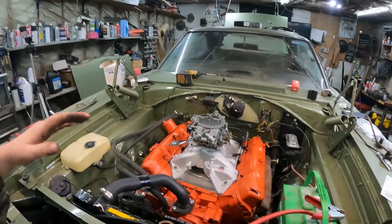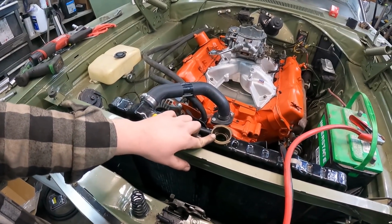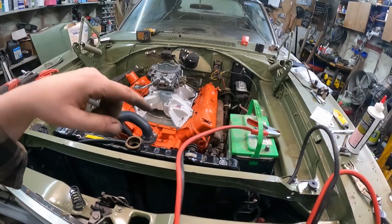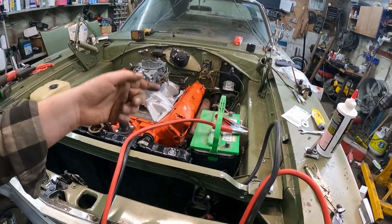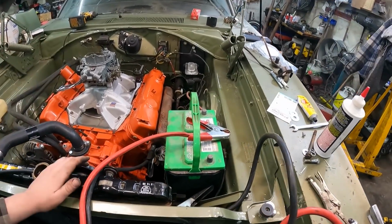So careful what you ask for, buddy. He asked what it was for. I told him, and he says it's ready to go. We'll see what happens. I got a bunch of jets and all that if I have to, but I'm stoked on it. One thing, the coolant didn't leak down, so I don't think I have any leaks, which is awesome. I'm going to get the plugs in, and I got to figure out how to get it wired so it'll actually crank with the key, so I got to get under it and get the neutral safety on the transmission on these stupid Chryslers.